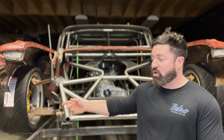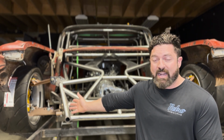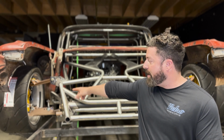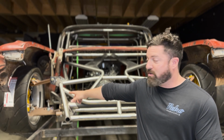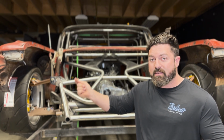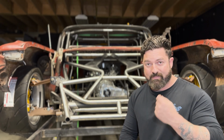So by using all this Corvette geometry style stuff, I really easily made a connection point for the all-wheel drive system in the front. And what you'll see here is we'll do a little recap. This is just a billet knuckle with their upper and lowers and a rear bearing in the front, tied together. Boom, we have our connection point for the front of the all-wheel drive. So keep that in mind if you want to build an all-wheel drive car and want to not machine stuff.